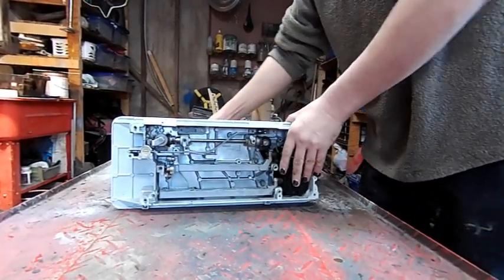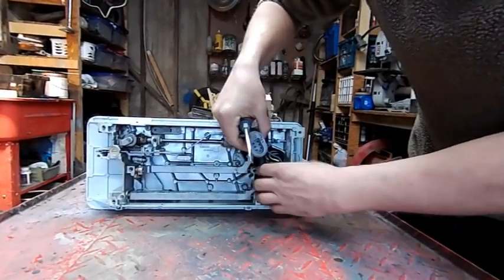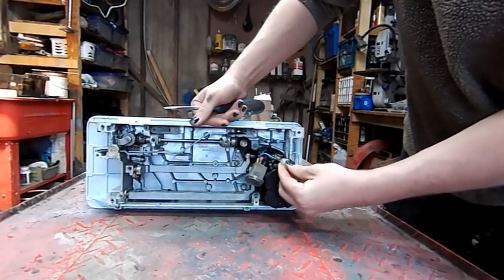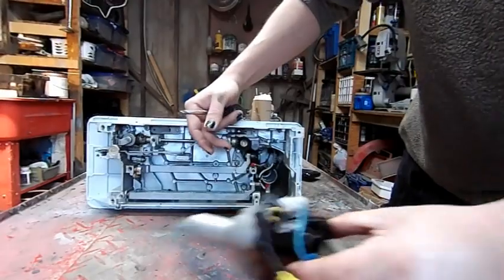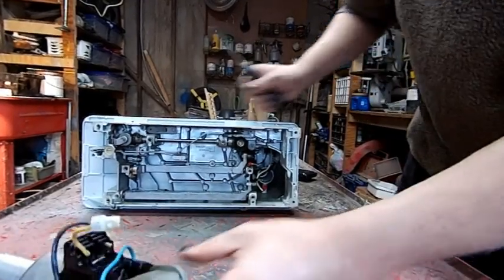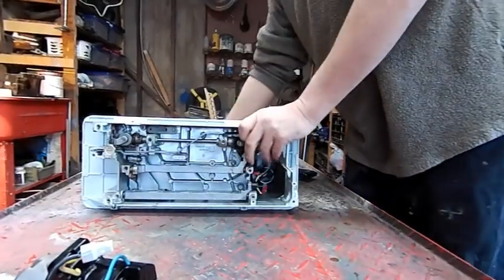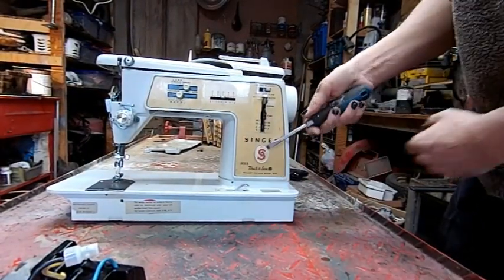So I removed that. The next thing I'm going to do is wiggle this motor out — it's kind of a pain. Just like so. Now the motor should be tied in similar to this — I'm going to pull this connector, pull this connector, and slide the whole motor out. Remember how you pulled those out. I've done this enough times I know where they go. And I can see we've got some lovely cheese repairs — I don't know what this is, but I'm guessing that's to the light. The next thing we need is the switch, otherwise you're going to have to try to do your own switch. We're going to pop this off.